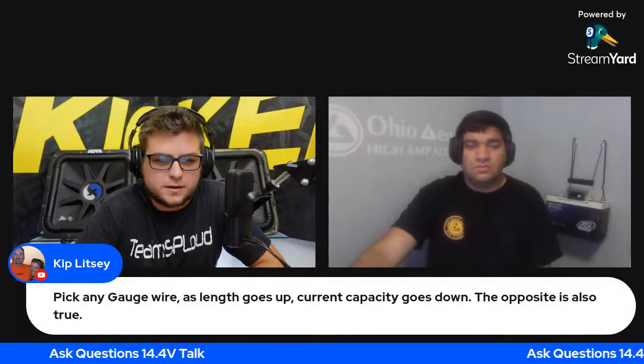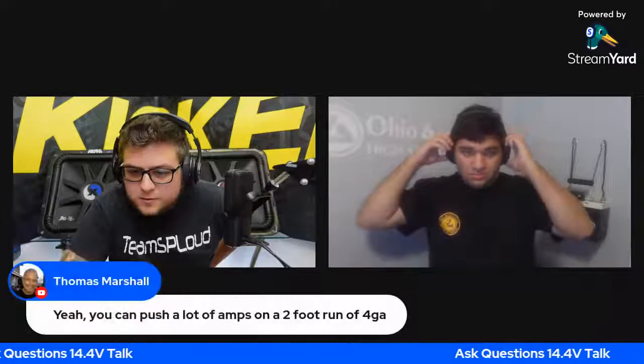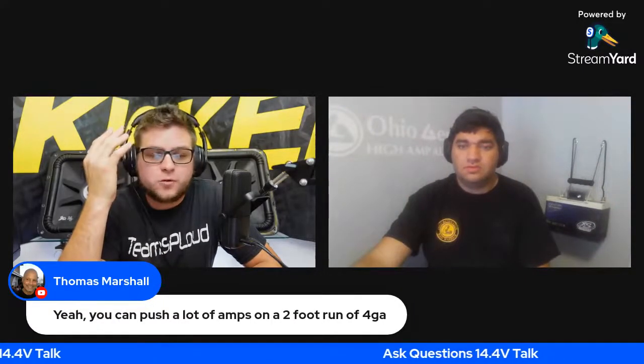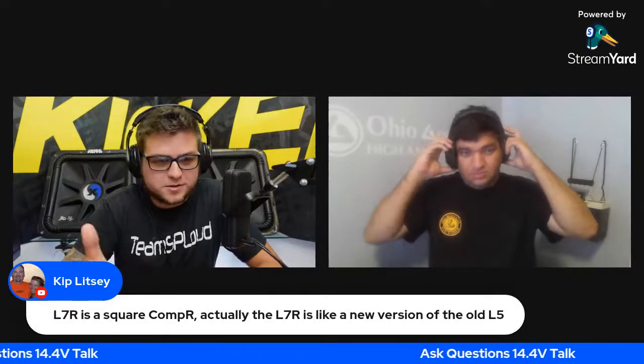Absolutely. Pick any gauge wire. As length goes up, current capacity goes down. The opposite also is true. Absolutely. Thank you, Kip. Yeah, you could push a lot of amps on a 2-foot run of 4-gauge. I know whenever I did Kayla's old school SPL run, I think I used a JYHP 40, but I only used 8-gauge wire, and I was clamping like 1400 watts out of that one amp on 8-gauge wire. Not recommended, but it was only a foot long, so.